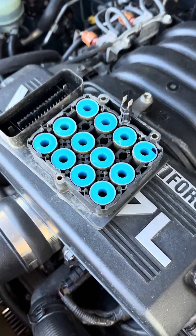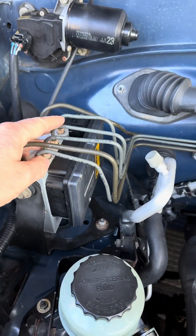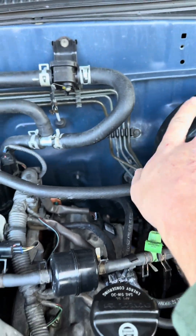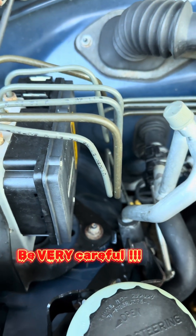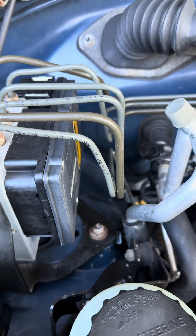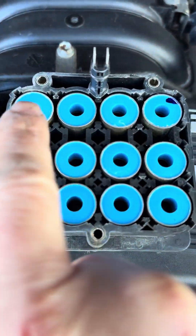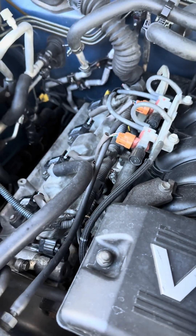There it is, off the other one. It's a little bit of a pain. You have these little plugs, and this one here is really long. You can crack all these loose but you have to re-bleed the brakes — that's a pain. What I ended up doing was taking the 10mm out there so that these lines will move a bit. I basically pushed these out of the way about a quarter of an inch, bending them out of the way, until I had enough room to barely slide it out. They say it's really important not to make any of this dirty — don't clean it with any solvent if you can help it, just do it the way it is and put it in.